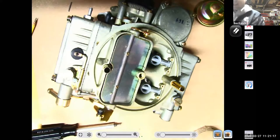All right, so all these were conventional, but I do have a question. Should I run a fuel filter on my bike? Yes. Run a fuel filter. And if it's going to sit around, run some fuel stabilizer in the fuel. It might even have some in the tank, little filters. Yeah, a lot of times there are little filter screens on top of your petcock in the tank, but an external fuel filter is always a good idea.